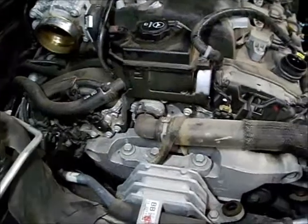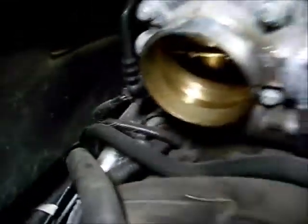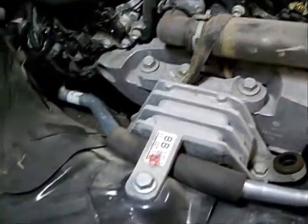And eventually this upper radiator hose and this outlet end. I think before I take that off, I'll raise it up and get the antifreeze out of it. Getting that air cleaner out of there. Really stuck in there. We've got to take a tube loose and push back on it. Take all the screws out of that. And then the whole top just hinges, it doesn't come off of there until you straighten it clear up.